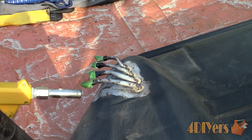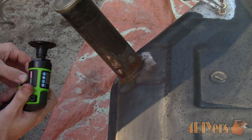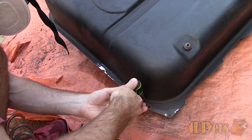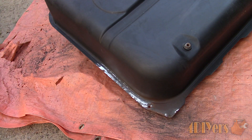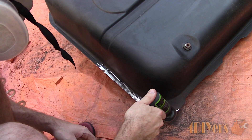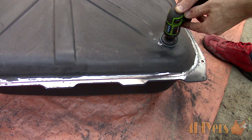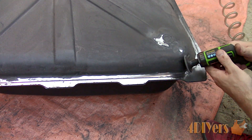I am using glass bead for the blasting media. If you don't have access to sandblasting equipment, you can also use a surface sander with 80-grit sanding discs — abrasive pads can also be used and will strip the surface quite efficiently. The surface sander I'm using is by OEM Tools, model number 24417, from mobile distributor supply — a link will be included in the description. It works excellent with small portable air compressors, is relatively quiet and compact, allowing you to get into tight areas. While I could strip the whole tank to bare metal it wasn't really needed — the areas with rust will be addressed accordingly. I was also noticing some mild rusting around the seam so this was stripped to bare metal as well.